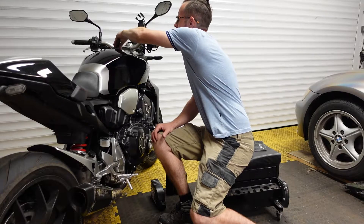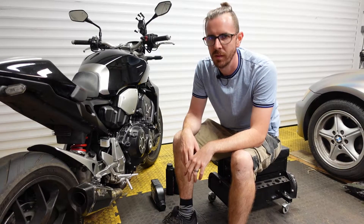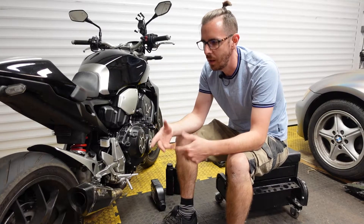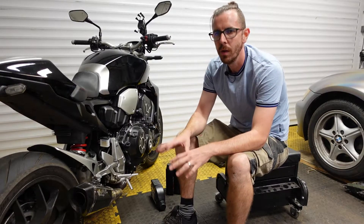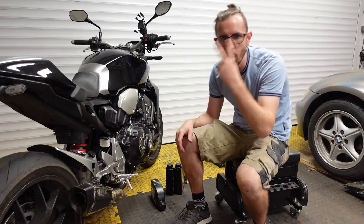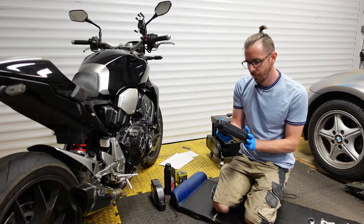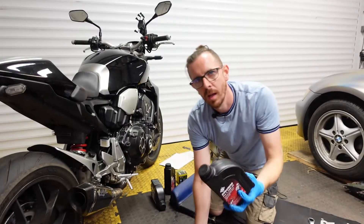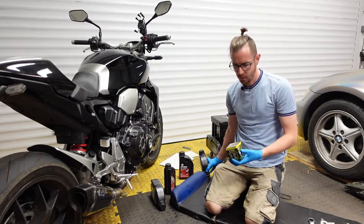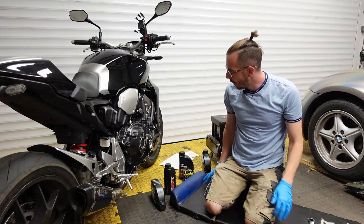Right, it's been running about ten minutes - just enough time for me to put my number plate back on since it fell off on my last ride out. It's up to about 85 degrees C; the fan hadn't cut in so I probably could have left it a little longer, but it's warm enough. Now, let's quickly discuss what we're putting in: I've got Silkolene Pro 4 10W-30. It should take three and a half litres, so I've got four litres. We're going to be using a high-flow racing filter, purchased from Moto Edit in Huntingdon.